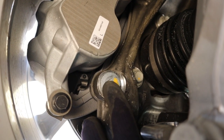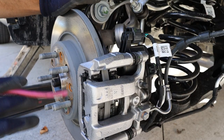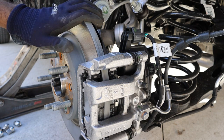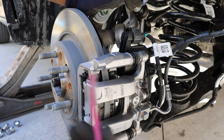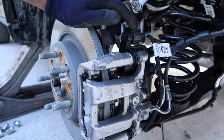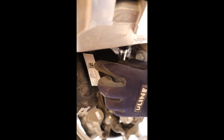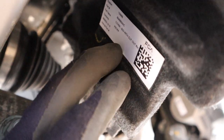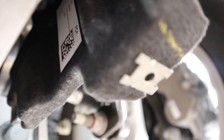It's interesting to see E-Torx fasteners on domestic vehicles — those are usually reserved for BMWs or something. Taking a look at the rear brakes, there's a single piston rear caliper design on a solid disc rotor. As for the parking brake, they've changed it from a mechanical drum style to an electronic parking brake — I hope you don't need a scan tool to change brake pads. Amusingly, this closed-out panel here says it's made by FCA even though this is a new Stellantis platform, and then on the right side the label just says 'cover with big cutout right-hand side.'